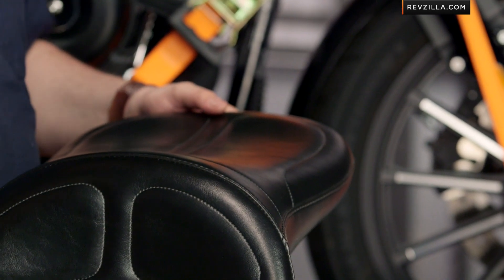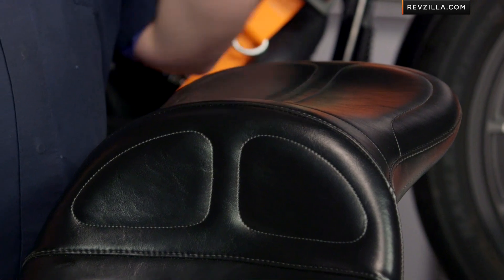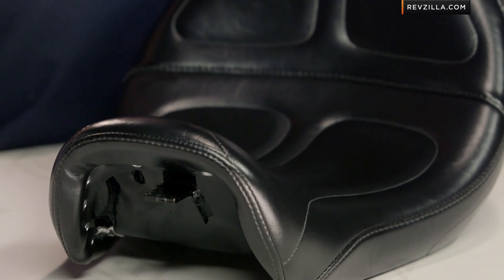Let's talk about install. Installation like all the seats is cake. On most Harleys you've got a tongue at the front — it's going to slip into your frame, and at the rear you have one point of connection. Depending on your year, make, and model, and whether or not someone's been in there before, you're going to have one bolt. Should just be a quarter-twenty screw — you might be looking at a flathead, a Phillips head, or a Torx. Regardless, one tool should get the job done. You should not be in the garage for a long time, and no one should be afraid of attacking a seat.